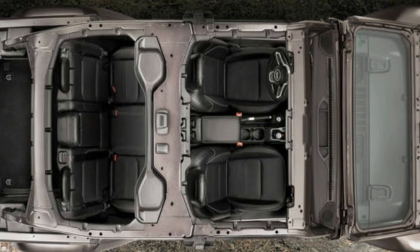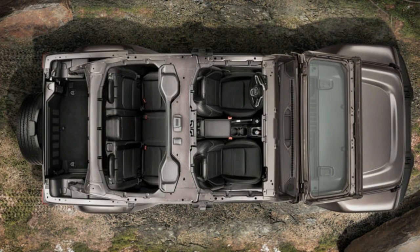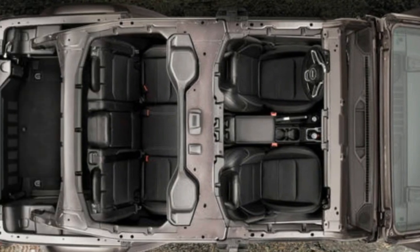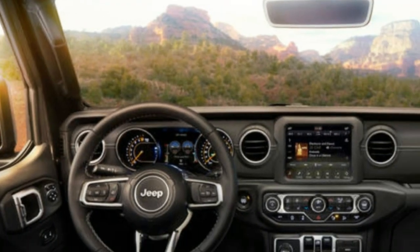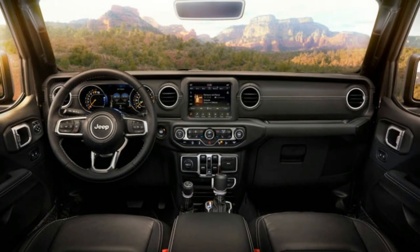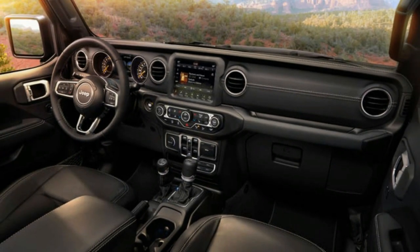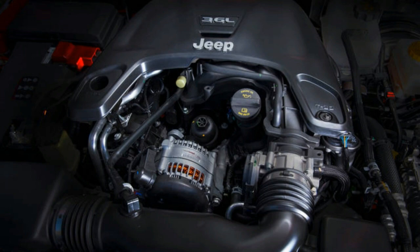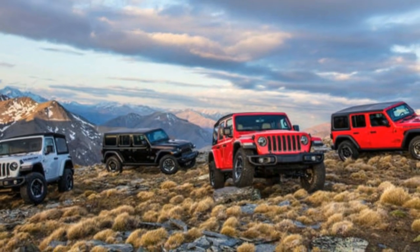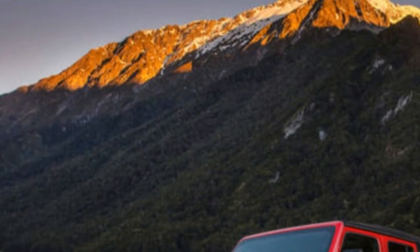Reason 5: Fast-Fold Windshield. Jeep knows that few people actually fold down the windshield on their Wranglers, though the feature has been present since the first Willys MB models of the 1940s. When the JK Wrangler launched in 2007, the procedure became tedious, requiring the removal of 28 bolts. It was prohibitively time-consuming. Additionally, because the roll cage mounts were bolted directly to the windshield, when you folded it down, you lost structural integrity. Now, there are only 4 bolts between you and open-air freedom, and Jeep has engineered the header to stay in place when the windshield is folded down.